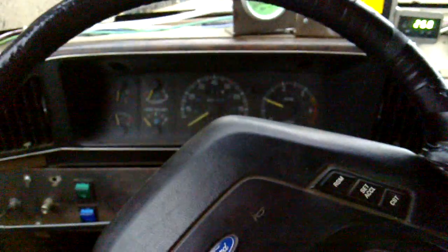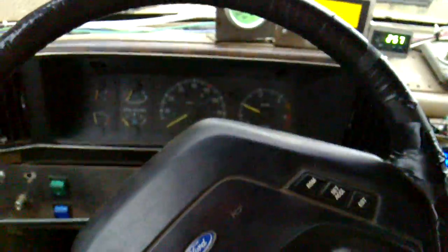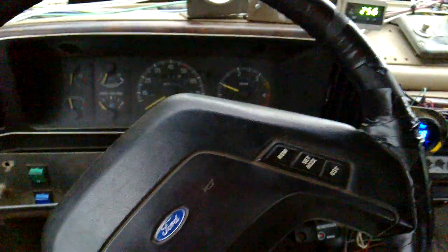Okay, test two. I've just swapped the hoses going into the Hydroboost, and now it works right. Spin the wheel — nice and quiet, quiet and smooth. Press on the brake, nice smooth linear action with a slowly increasing sound.